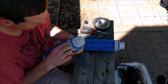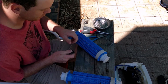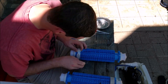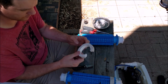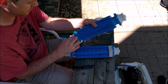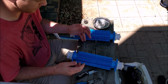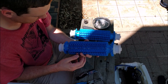The ones I currently have on here are very hard, so I don't think I'm going to be able to just stretch them off. The squirrels have done a nice job removing the first two for me, but I'm actually going to need a razor blade to remove the back two. You can see how hard these are — they're definitely not very movable anymore. Be very careful when you're cutting that so that you don't cut any rubber part. We'll do the same thing for the other side. I'm going to go ahead and wet this down so that I can get all the gunk off, and then I'm going to install the new ones.